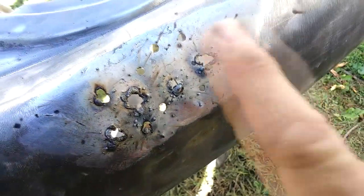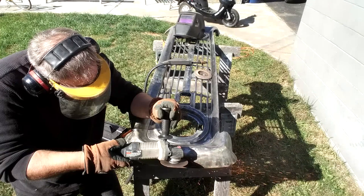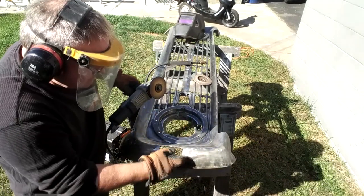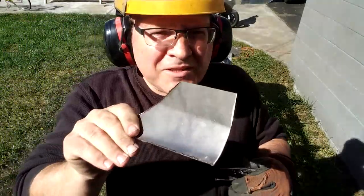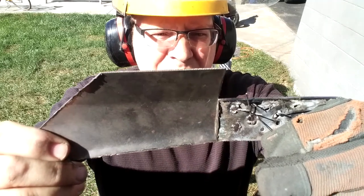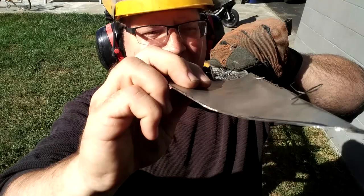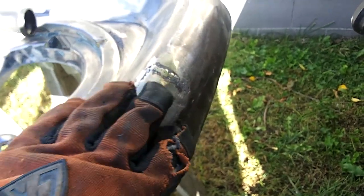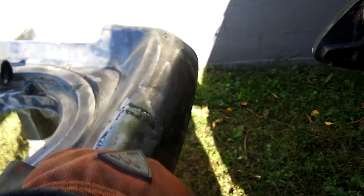This is what I attempted to do but it's carnage everywhere. I took this piece and put it in the vise — you can see where I've been at it a little bit. I cut it out of the measurement which is a good thing. It's a pretty good match; I'm not sure how well you can see how that's going to line up. I put that piece of metal in there and got some booger welds on it and ground them down. It's got some low spots as you can see right here and here, but I'm going to fill this whole thing in.